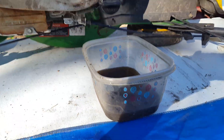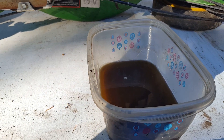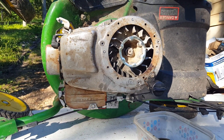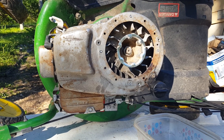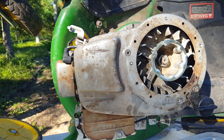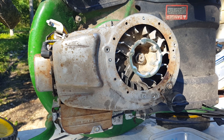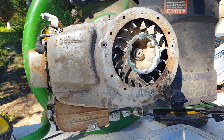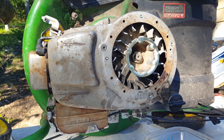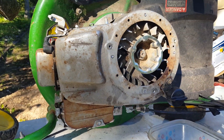I got the oil cleaned up as best I could — I did about almost 10 oil changes. I used a drill with a socket to stir up the inside of the crankcase and get all that water out. I'm going to stop there on the oil flushing and put a fresh one in. It's empty right now — I just drained it — and I'll put new oil in it.